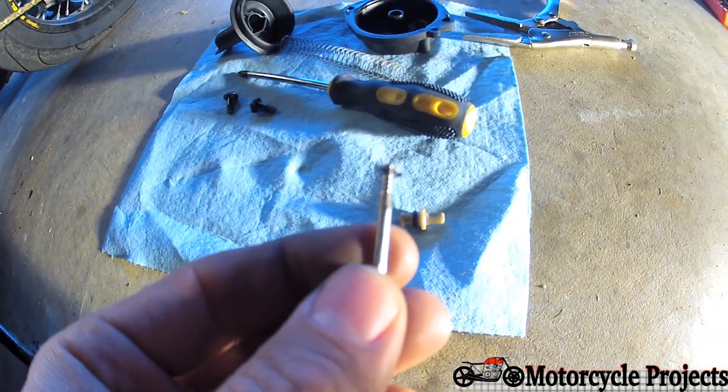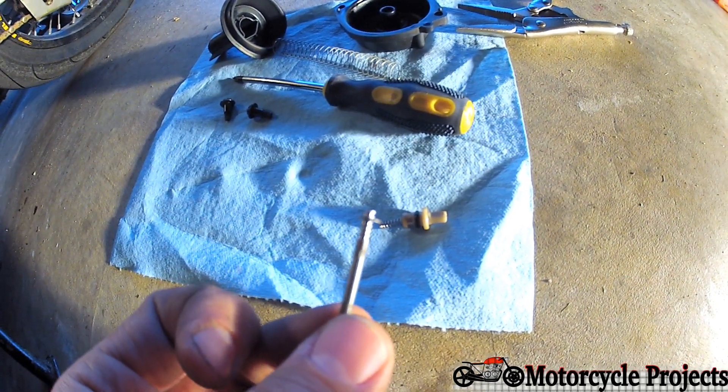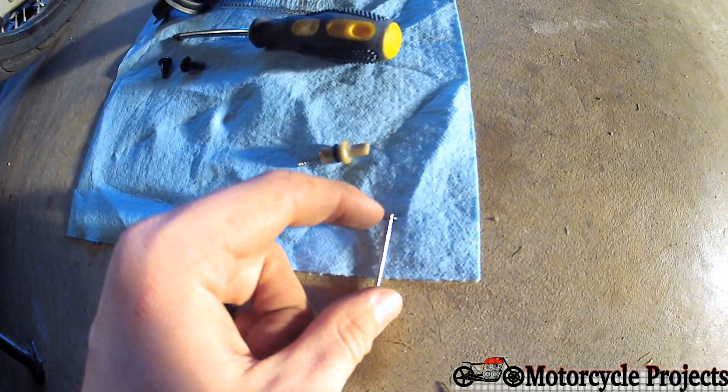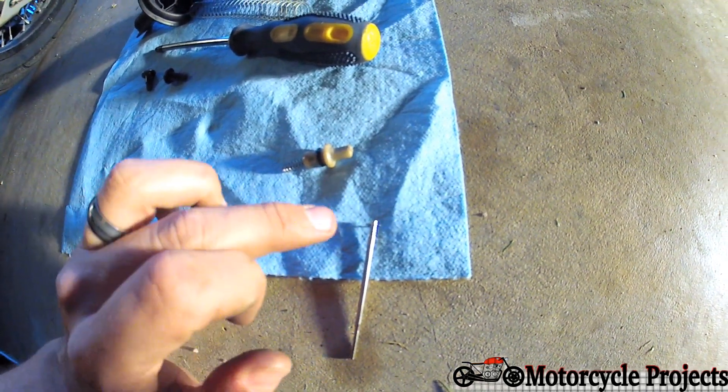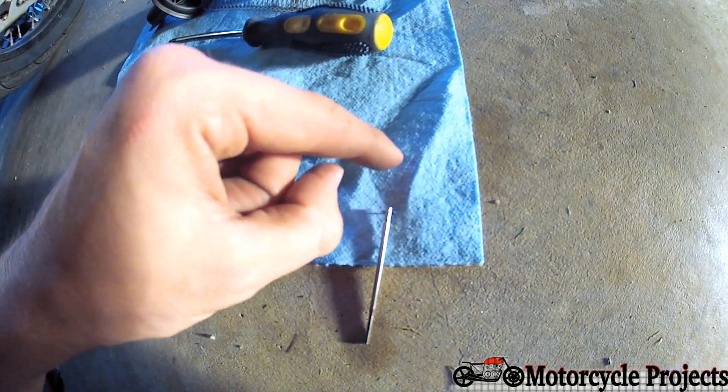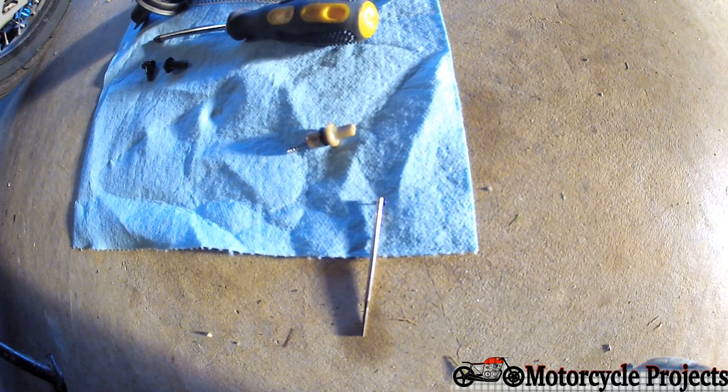As you can see, there are several grooves in the top of this needle, and those grooves are there to allow us to make jetting changes. This one is currently in the second position — numbered from the top down to the point of the needle: one, two, three, four, five, six. We're going to go all the way down to setting number six. Stock, the bike needs about a four. With the mods we have on it, it should be five, maybe even six. I know what it was running at with five earlier and moved it for demonstration purposes to indicate the changes you need to make because of altitude or similar factors.